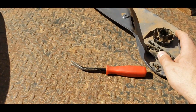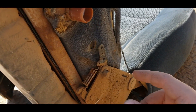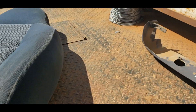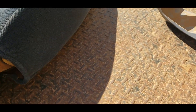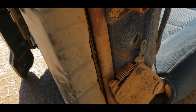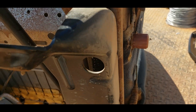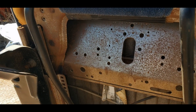I have the trim off here. Your lumbar adjustment pulls off — takes a fair amount of force, so just pull evenly on it. There's a little screw in the center of your lean-back adjustment handle that you'll have to remove. There are two screws underneath here that hold this part in. I do not recommend prying on the little rivets on the front. On the rear, there is a little plastic rivet — I broke mine; there wasn't much there keeping it on.